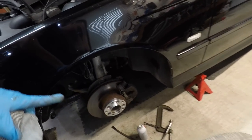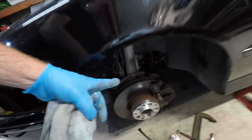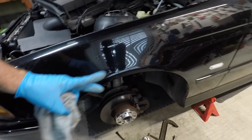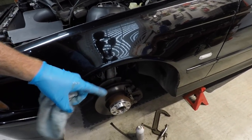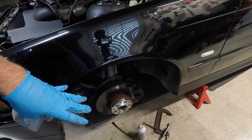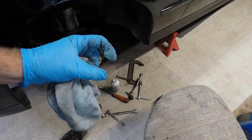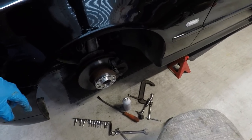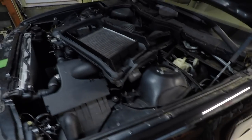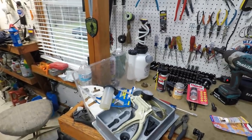This side is done. The brake pad wear sensor — I just zip-tied it up out of the way. It still worked and wasn't kicking the light on; I took it out and zip-tied it because it was a little broken where it pushes into the brake pads. I did use a C-clamp to push the new caliper all the way in with the new pads. This isn't really a DIY how-to — this is more about what to watch out for when you're doing it.